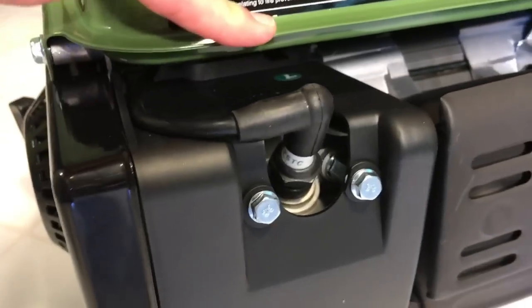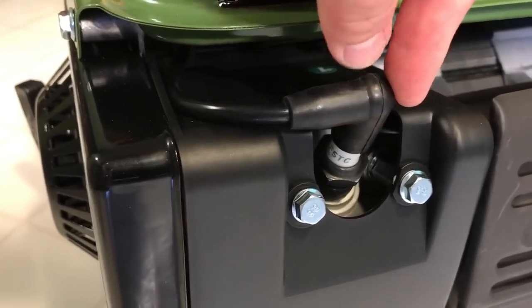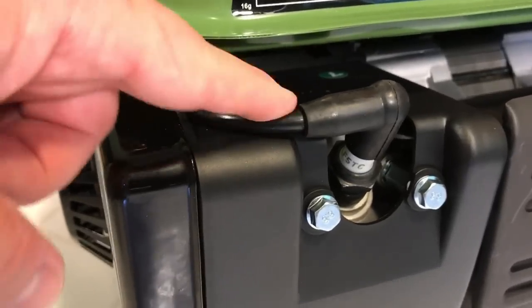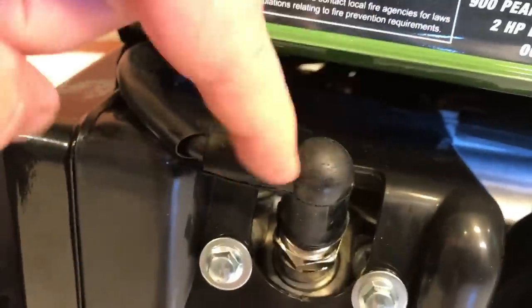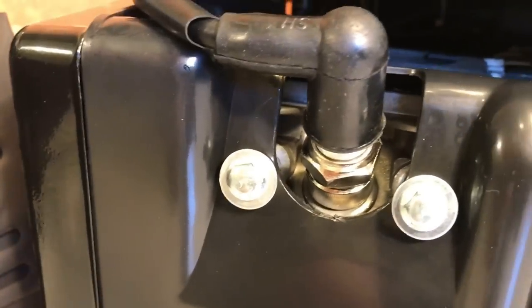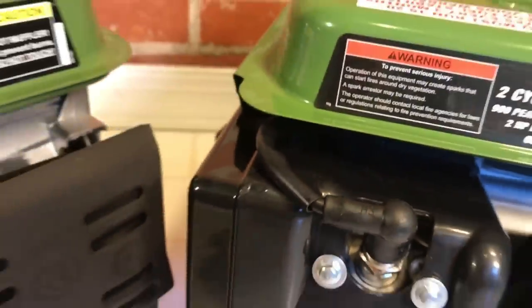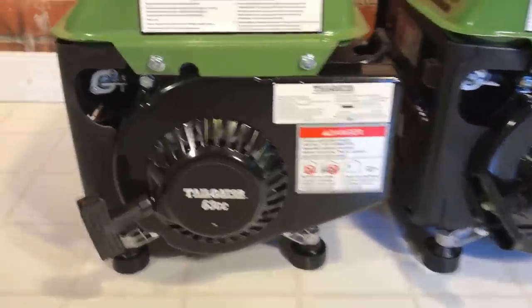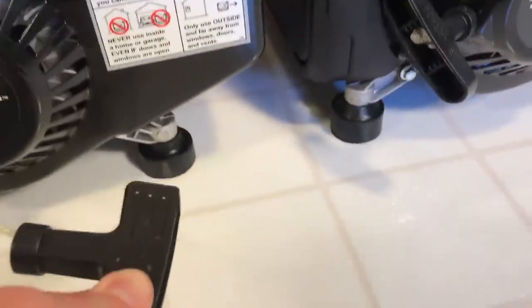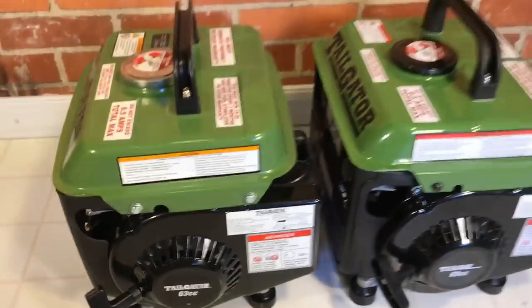The spark plug story is exactly the same as the old model numbers. The 63025 has an F5TC plug with a small, super flimsy little plug boot and no insulation covering or shielding on the cable. The 63024, just like the 69381, has a thicker plug boot that goes down further, an F7TC plug, and shielding insulation on the spark plug cable. Those pull start handles — the 63025 is square, while the 63024 has a smaller, more tapered profile, just like the two old model numbers.